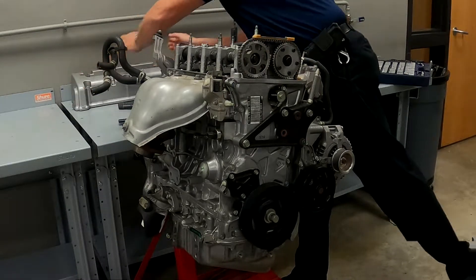The next thing is to take the crank bolt loose. In order to take the crank bolt loose on a Honda we have a special tool. This special tool looks like a great big nut that fits on like so — this is the holder — and then we're going to break it loose like that.